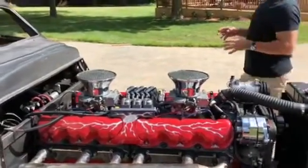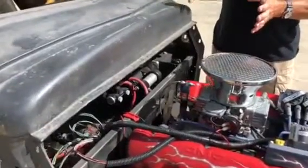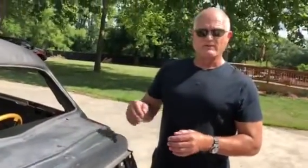To complement the engine, we looked for a transmission that had the ability to handle that kind of torque in case we ever put a trailer on the back of this thing and pulled a load with it. So I have a Jake's transmission 4L80 that they built specifically for this engine. They're out of Texas, and they build monster truck transmissions, so that's basically what this is. It is a 4L80 casing with all billet internals, and that is a 2,000 horsepower continuous use transmission with a